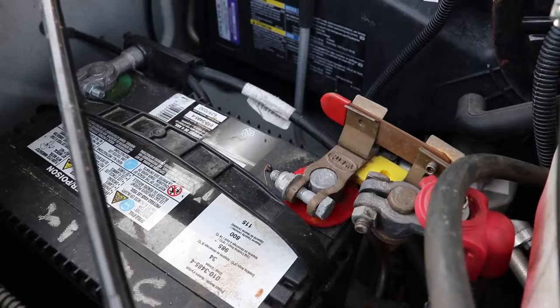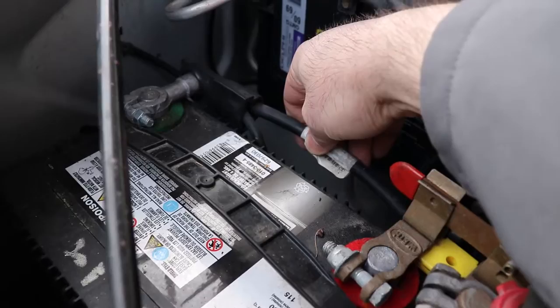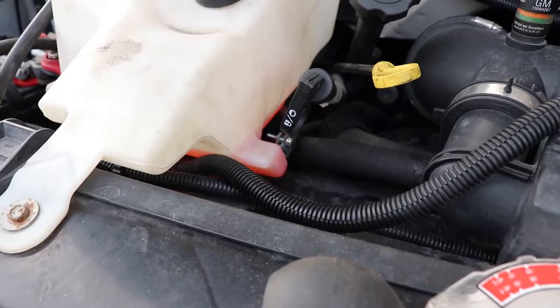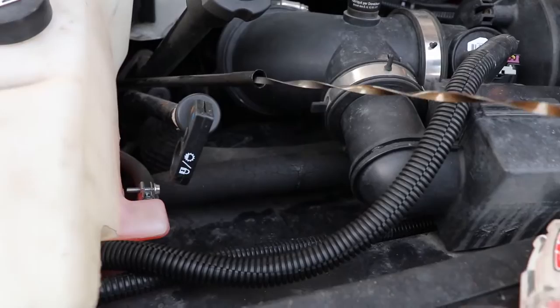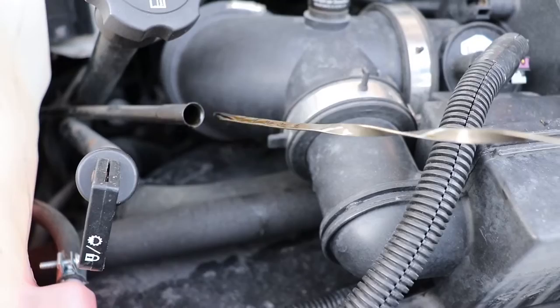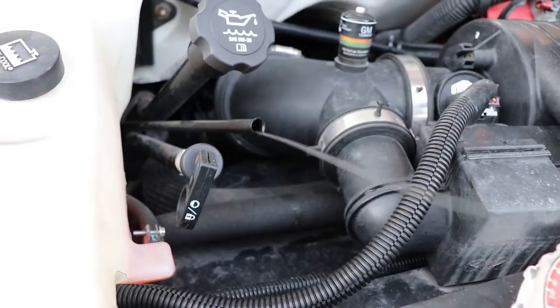This vehicle still has GM battery cables on it, but this battery doesn't accept GM cables, so we have adapters on here. Check your antifreeze — it's a bit low but I had done some work in the fall so I was anticipating that. Check the engine oil to see if there's any coolant or anything in it — check right to the bottom. It looks good, which means there hasn't been any catastrophic failure over the winter from water in the engine freezing.